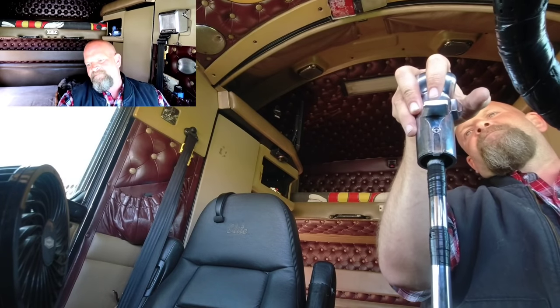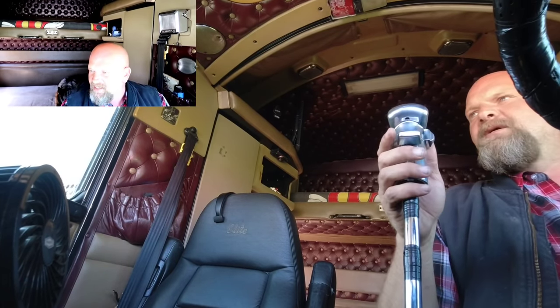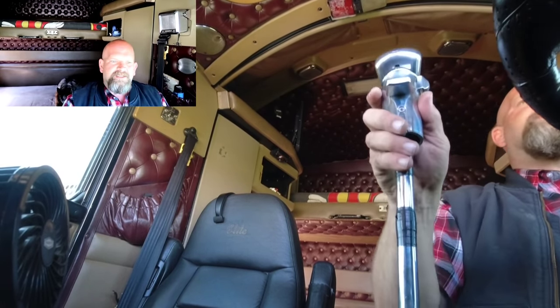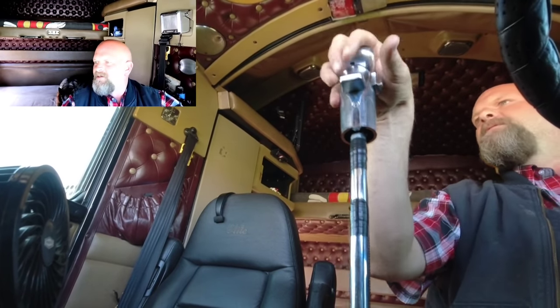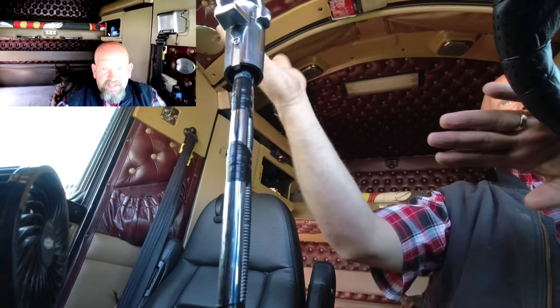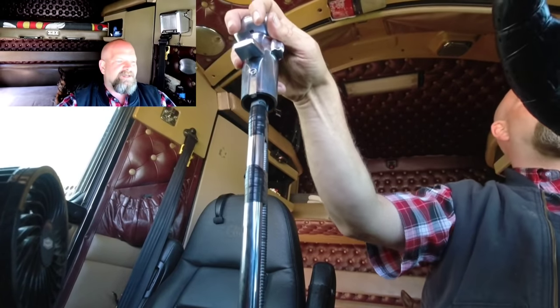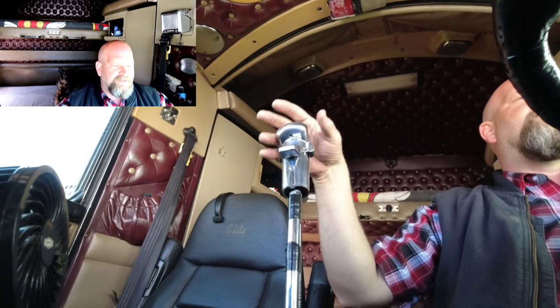All right, right now, this is what you would call low gear. I always start off in low gear when I'm loaded. Every once in a while you'll see me starting off in first gear, I guess, the next gear up. But in low gear, when you're starting, you really barely have to touch the clutch. So technically this would be your first gear. Your second gear, your third gear. Hope you guys can hear me okay. We really haven't tried this. And that would be fourth gear. In my head, that's fifth gear, but if you look at the diagram, that's fourth gear.